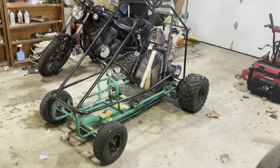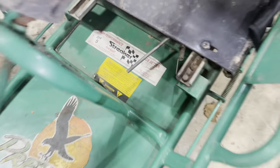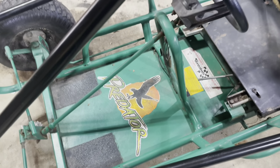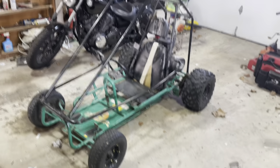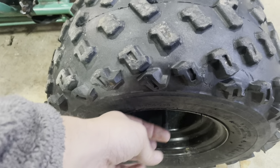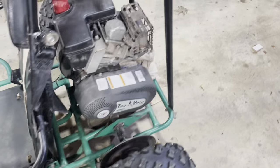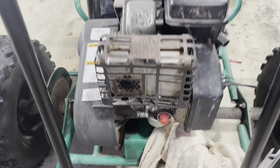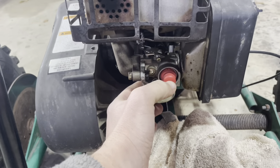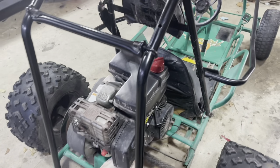Today's project is an old go-kart — a Kembar Streaker. I've never seen one with the predator logo on it. I just picked it up a couple days ago and it's in somewhat rough shape. Someone painted the wheels black — I think they originally came yellow. This valve stem is not the right type for this wheel; the seat is torn, half of it missing. I was told it ran and had a new carburetor put on last year, which seems somewhat true — the primer bulb looks pretty fresh. But it was leaking gas when I picked it up, so probably a cracked fuel line, hopefully an easy fix.